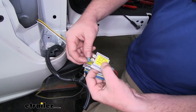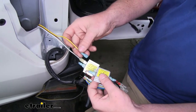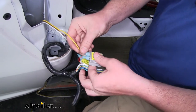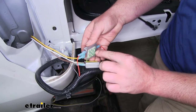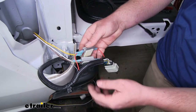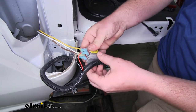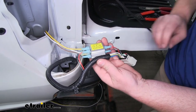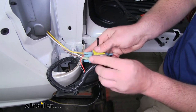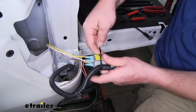Take the other end of our red wire and that'll go to one of the ends. Finally, the single yellow wire from our new harness will go to the other end terminal. On the back of our diodes there's some two-sided sticky tape — peel that backing paper off. I'm actually just going to stick the two together and secure our wiring and diodes together using one of the zip ties included with our kit. That'll help keep them from bouncing around and possibly getting damaged.